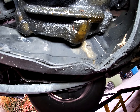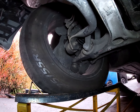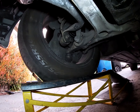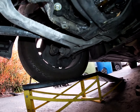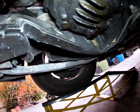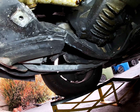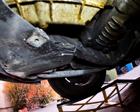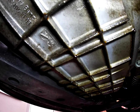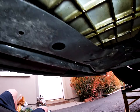Hopefully that's the output shaft seal — so I've got to change this axle because the boot is ripped. Need the control arm, pretty much almost all the suspension, definitely the sway bar. That's what it looks like out here. Oh man, it touched the case right there — it hit hard. I hope the case is not cracked; I doubt it. I don't know what they hit, but it is leaking from the drain plug — that's why it's wet under here. Didn't even touch the oil pan.